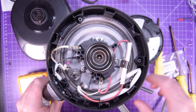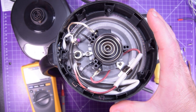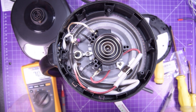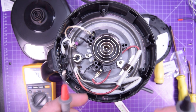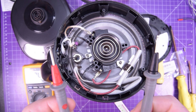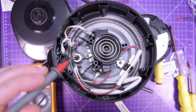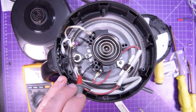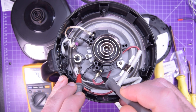There's a quick way to test it. Just grab your multimeter in continuity mode. If you're not comfortable using a multimeter, check out the link up here or in the description for my tutorial on how to use one. You put your multimeter into continuity mode so when you touch the probes together it makes a noise, and if it's not connected it doesn't make a noise. So I'm going to touch one end to the heater element here and touch the other end to here.